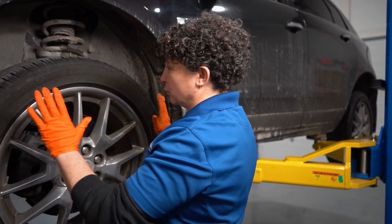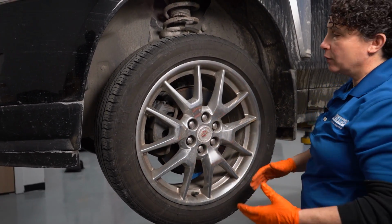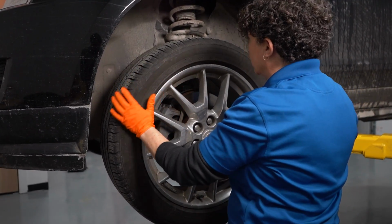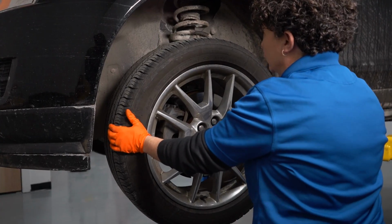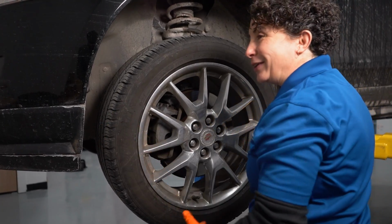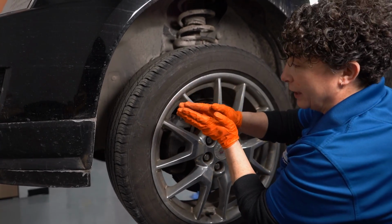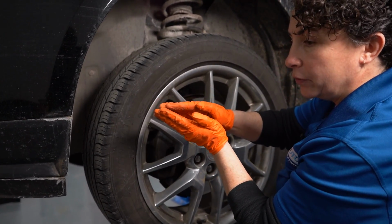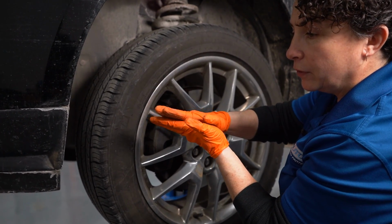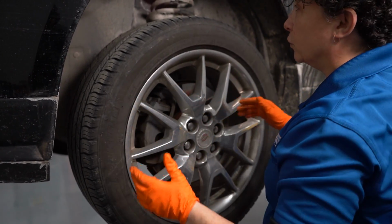All right, so now I'm just going to run over real quick how I do a front end check. I raise the vehicle up. If it's a truck, I do need a jack so that I can actually support the lower control arm. But with this one, I can totally check it in the air. If I turn the wheel, I'm checking tie rod ends right now, and I go like this, you can actually hear the other strut cap. It is so bad because it has no pressure against it. So it's got an air gap in there, so the bearings aren't rolling on bearings. We're rolling on probably the outside of that rubber cap. Instead of flat like this and rolling on the bearings where it's smooth, it's bowed because there's no pressure pushing those two pieces together.